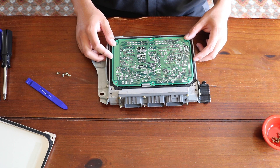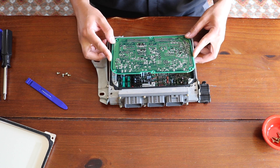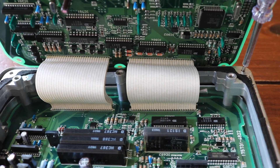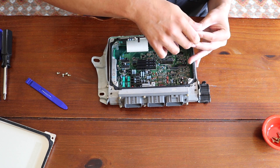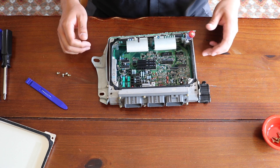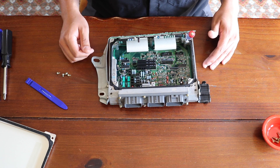At this point, pull up on the circuit board very carefully and very slowly, because below it there are going to be some ribbons and you don't want to pry on those. I did see in another video where somebody stuck a screwdriver right here to hold it, which actually worked out really nicely. At this point you can look inside your circuit board and look for those caps.